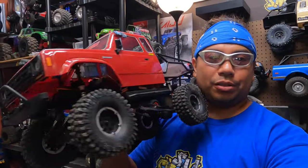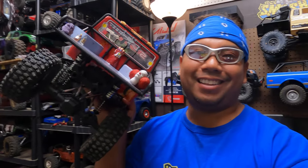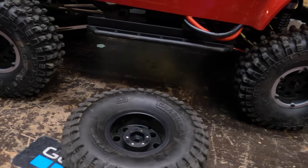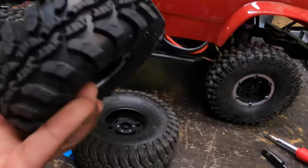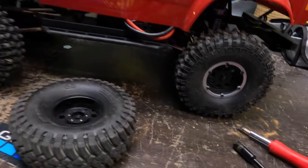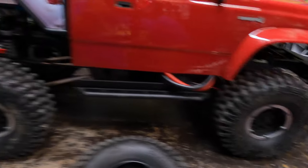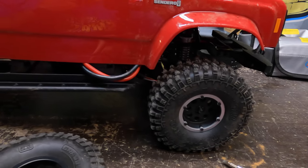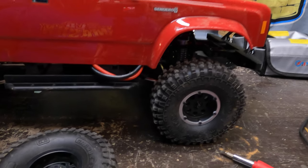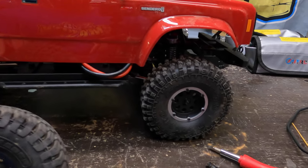Welcome back. Hope you all enjoyed the smashing action with this new customized Sendero with a Pennywise clown on it. The stock wheels have a really shallow offset, and the wheels on the X wheels are a little bit deeper in there, had a deeper offset. So I had some wheel hubs, I put them on there, I got them just barely to clear, they still rub a little bit. I was gonna fix them up, but these tires are a tiny bit better, they look cooler.